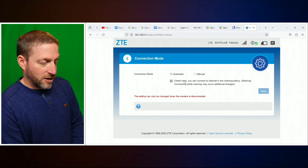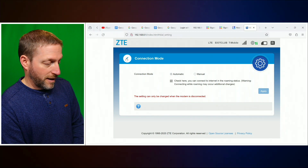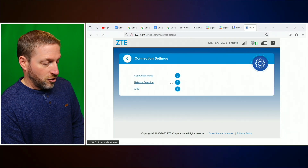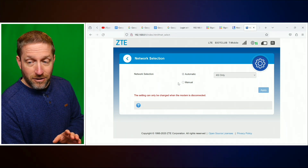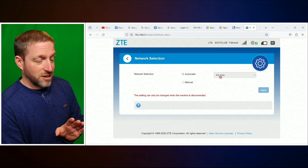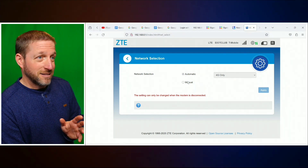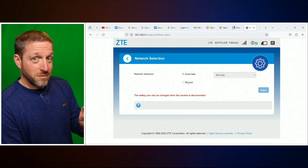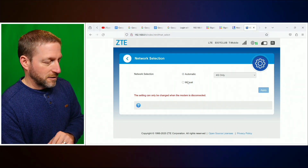You're going to check here so that you can connect in roaming, which is what I needed to do. Come back out. Your network selection — this is going to happen automatically. Right now it's telling me I only want it to go to 4G. I don't want it to look at a 3G network because that's not going to deliver the speeds I need. You could try to manually set something, but I've tried that, and sometimes when I manually pick something, that tower doesn't agree to give me service. So I just let it do it automatically.